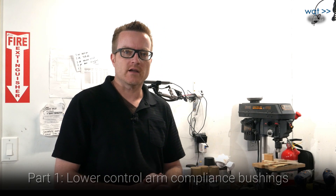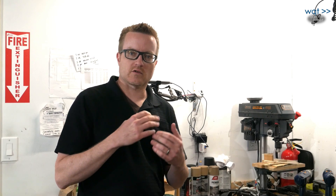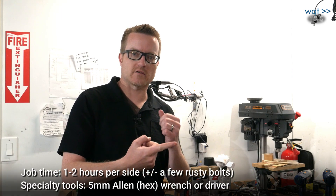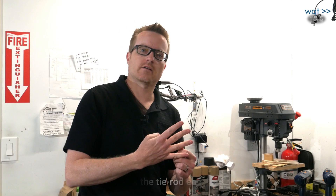Vibration in the vehicle can be pretty frustrating. In most cases, it has a simple solution — go get your tires balanced, and then if that doesn't do it, get a wheel alignment. We started there and it was still happening and slowly getting worse. So first we looked at the lower control arms, because this model has a compliance bushing that fails regularly. Then we looked at ball joints and found one that was bad. Then we looked at engine mounts and found the transmission side mount was going bad and another one was getting soft. Finally, we looked at CV axles and discovered a problem there. This is typical of high mileage vehicles. Strangely enough, that didn't solve the issue, and it finally did come down to a wheel — but not quite the way we thought. So let's get started by going out to the vehicle and tackling those control arms.